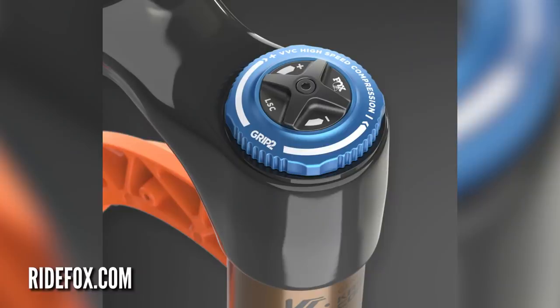As for the variable valve: the valve itself isn't just ports — it's got ports and shims, and you adjust the preload on the shims to adjust basically the rate at which it extends. It's a very good system, and certainly the best thing that Fox have done for a long time. I've got the 36 on the Reactor ST and haven't serviced it since I had it, and it still feels unbelievably smooth. Absolutely fantastic performance on that fork.